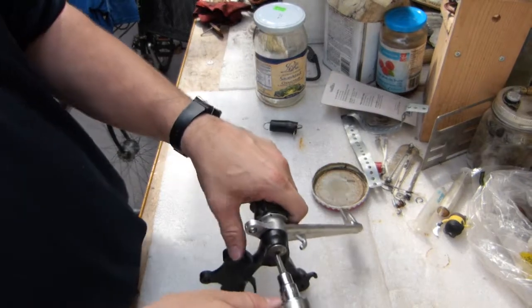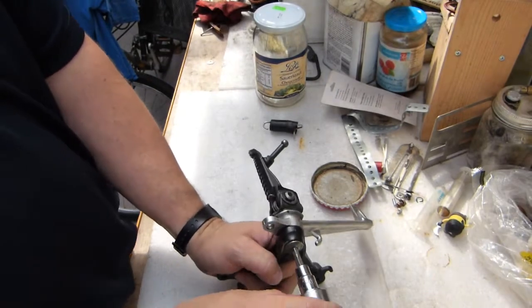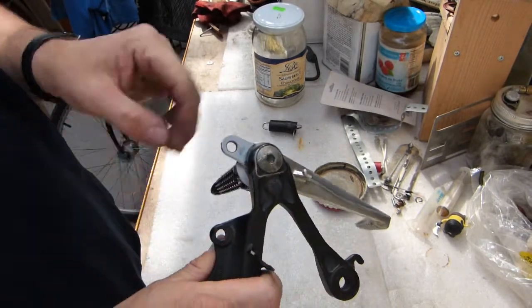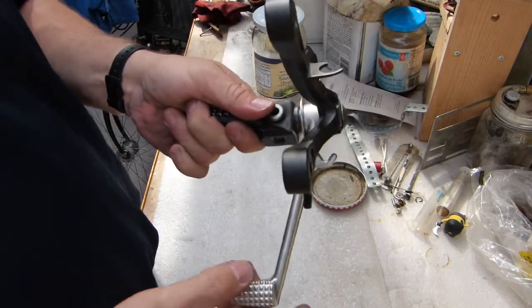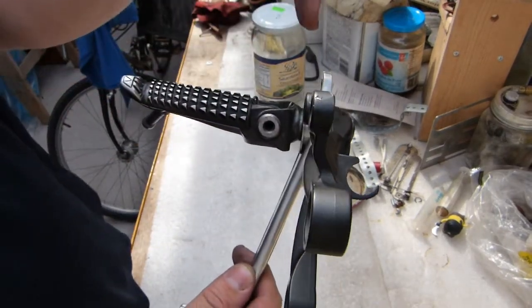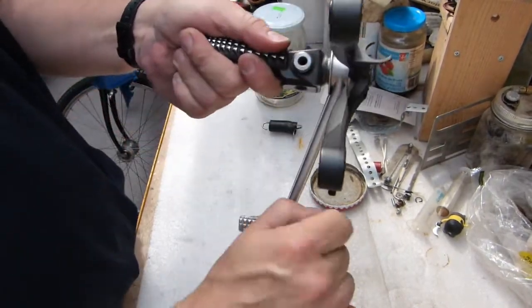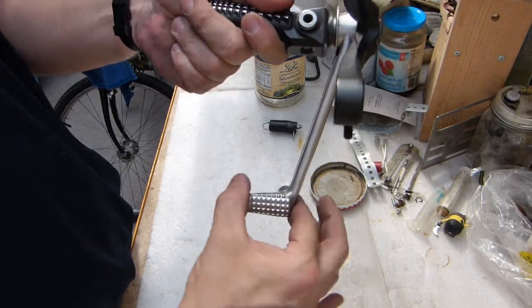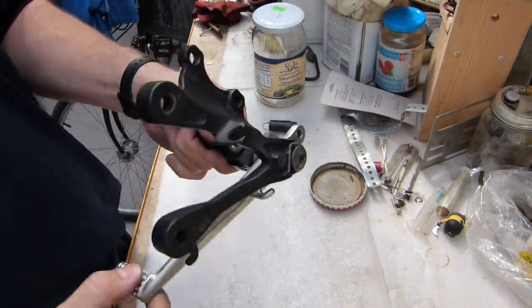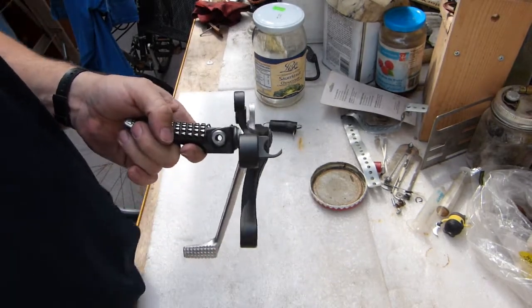And even when it's tightened to the specifications, which I'm just going to eyeball. This is a prototype. Okay, this is tight there. This should still be freely moving, and this washer keeps the brake pedal perpendicular to the foot peg, so it's not rotating sideways like previously this way. Okay, so that's how this fit looks. Don't force it any more than it should. So this is it: 1.3 millimeter thickness or 1.25.